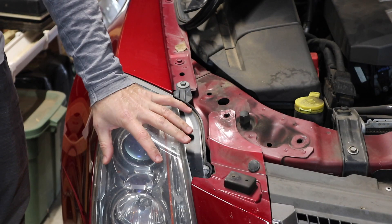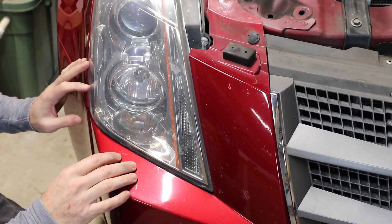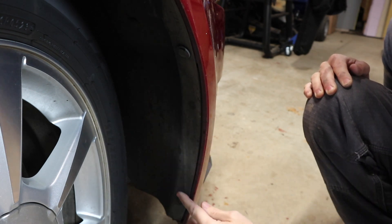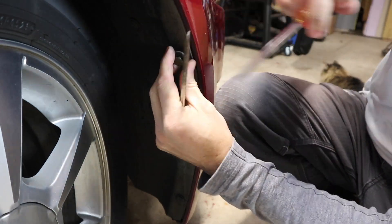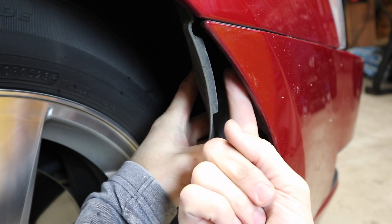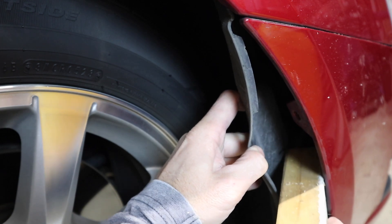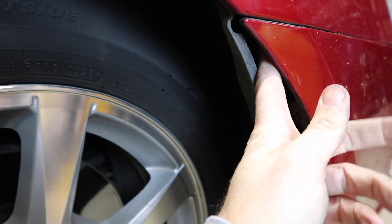The first bolt that holds on the headlight assembly is up here on the top, so you can do that first. The other two bolts are buried behind the bumper, that's why we have to take it off. To get to the other bolt you need to take this wheel well shroud off. It's good to turn your wheel in from the front so you can access these clips — there are two clips at the top and one clip on the bottom for a 2008. Pry them off with the screwdrivers. Once those clips are loose, pull back the wheel well shroud and the bolt is right up under the corner. You might want to put a little scrap piece of 2x material in there to keep it held apart while you thread it up to get the bolt.